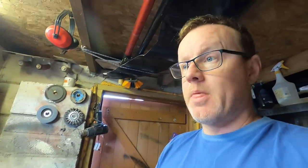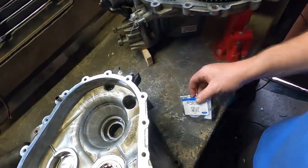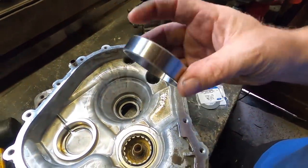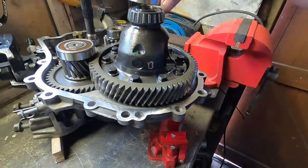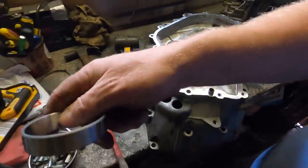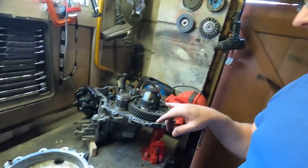If there's no squeeze you'll wear your bearings out; too much pressure and you'll wear them out too quickly. The Ford measurement is quite specific - it's 0.144 millimetres. This is where the shims come in. Down in there is a bearing race - this is a brand new one, tapered, and it sits in there. Just behind that is one of these shims. The Ford size shim in there is 0.5mm. Big thank you to Matthew Peterson from Autocross Fiesta in America - he gave me the Ford manual and a lot of information. I'll link him up on Instagram.